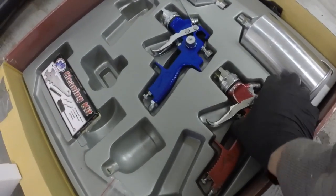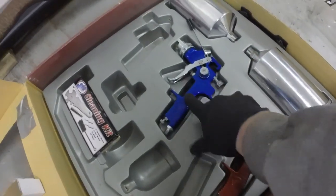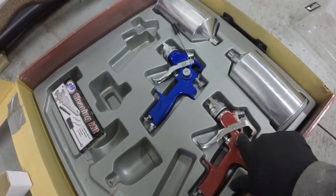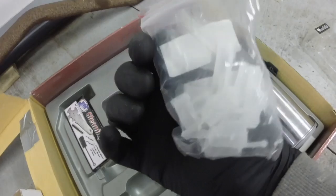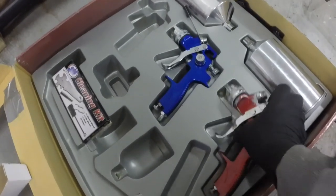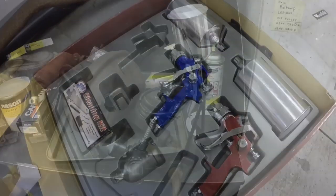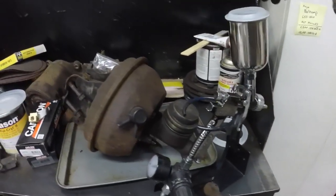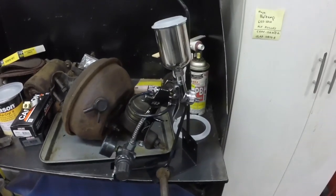When I'm painting the main body parts in the garage, I'll use the HVLP gun — probably use this gun when I paint the green. That's a primer gun, paint gun; the other one is obviously the door jam gun. All the little filters go right here where your paint can goes on. And you need one of these stands — this will accommodate both guns, both size guns.